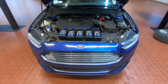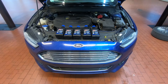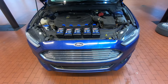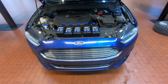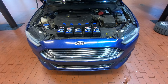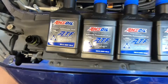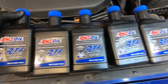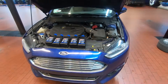Hello and welcome to the channel. On this episode of AB's service videos, we're going to be doing a transmission service on a 2015 Ford Fusion Titanium with a 2-liter EcoBoost. These vehicles are equipped with the 6F35 6-speed automatic transmission. We're going to be using the AMSOIL Signature Series ATF, and for one drain and fill you're going to need between 4 and 5 quarts.